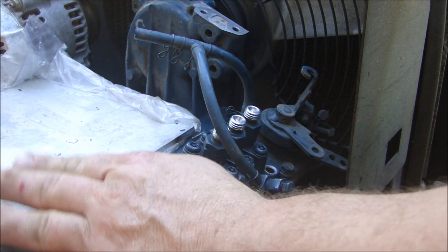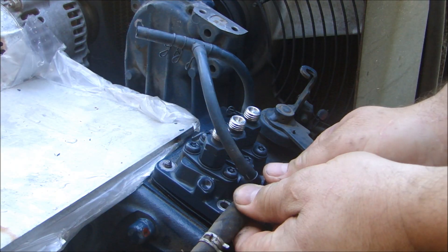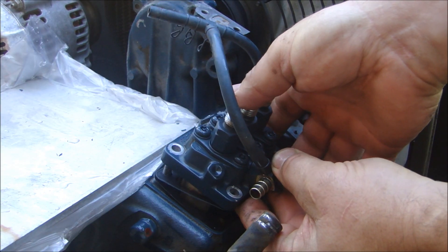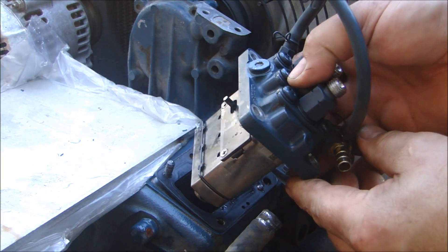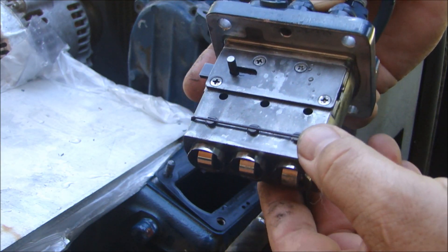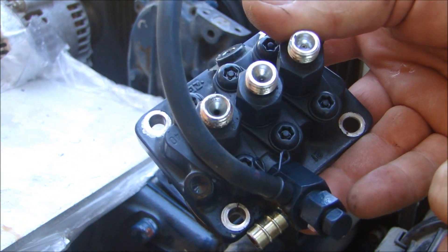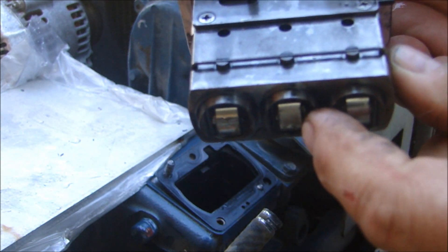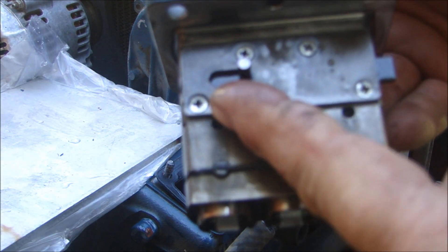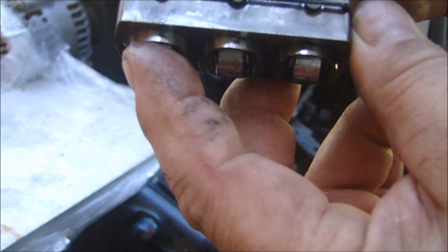I have the cylinder covered where I took the cylinder head off with plastic and some metal — I don't want anything to fall inside the engine. To remove the injection pump, all you have to do is take off your fuel line, take off the four corner bolts, and gently pull it out. As you pull it out, this shuttle disengages — you can see it moves back and forth, and this is what engages in the engine for the fuel pump. On the top are the lines that go to the injectors, and on the bottom you have these lifters. These lifters roll on a cam inside the engine — they get pushed up and down, and that's what compresses the fuel. Now if you look at these three, two of them are pretty stiff, but look at this one.